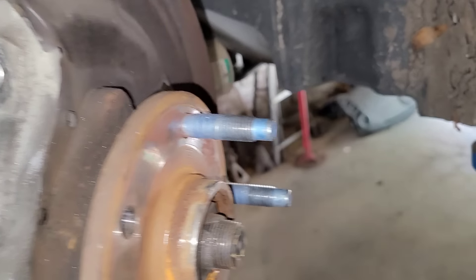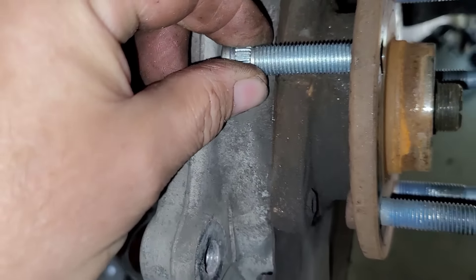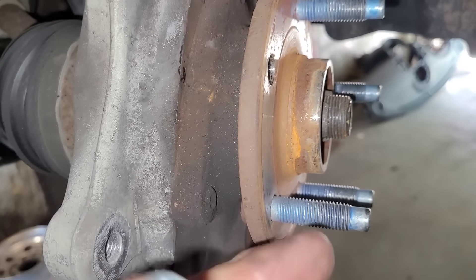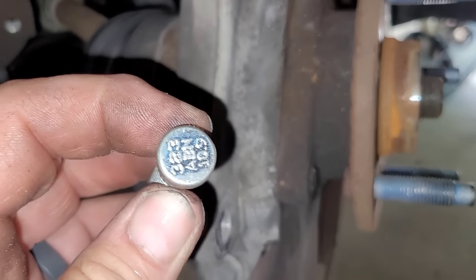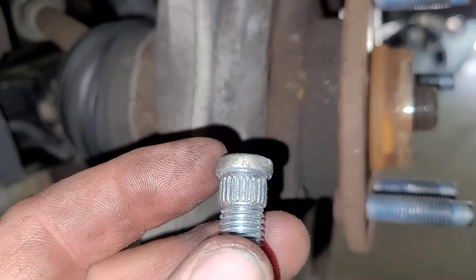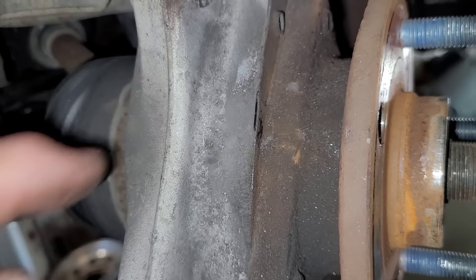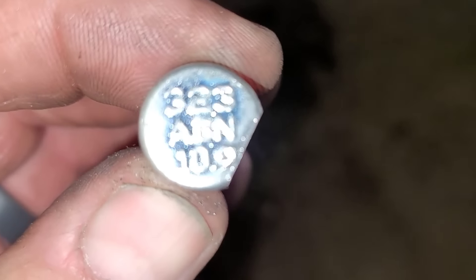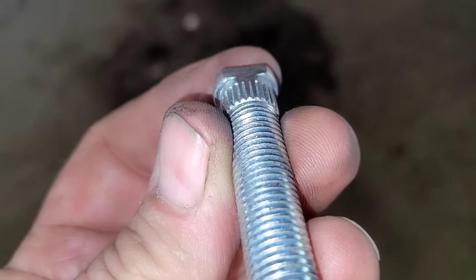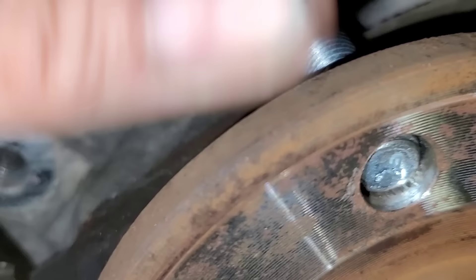Obviously the new stud isn't going to fit. So what do you do in a situation like this? There is a possibility I might have to unbolt the hub and pull it out slightly in order to get the stud in. What I'm going to try first is grind down part of this flat — some people may say you can't do that, you'll harm the integrity of it, but a lot of these studs come through from the factory with the end trimmed off for that very reason. Let me try that first. I ground off part of it — but here's the problem: it's still not going to go. It's way too much of an angle, unfortunately.